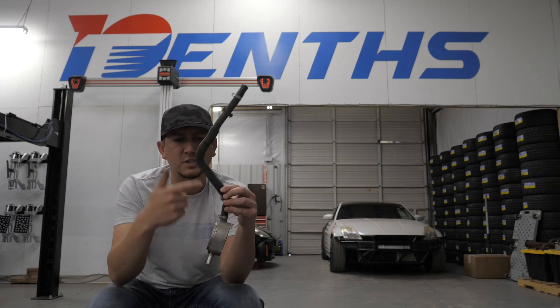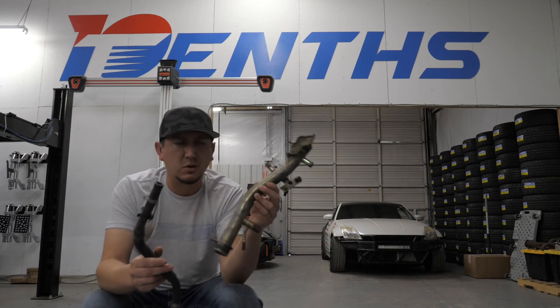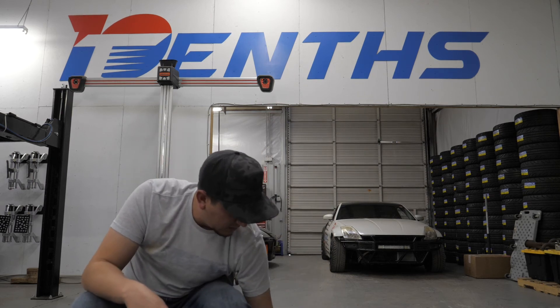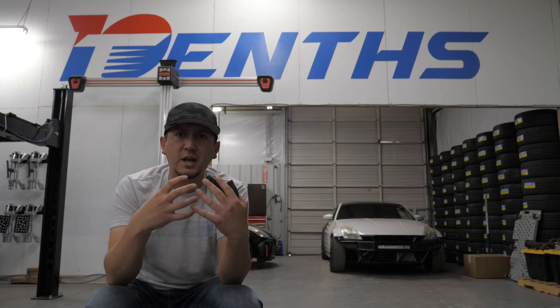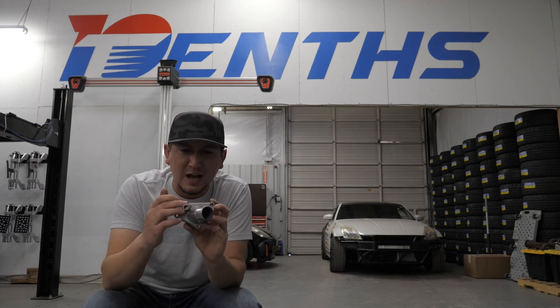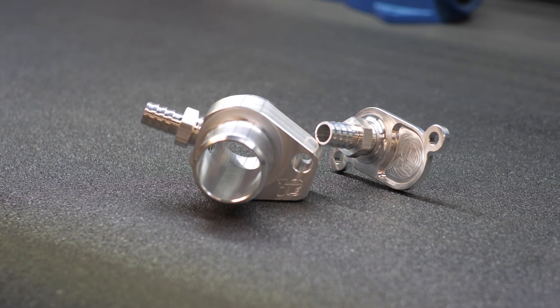This removes two hoses — one fed from what I believe is called the crossover pipe, going across the front of your engine, and then a hose that goes to the front of your thermostat. With our two kits, for the thermostatic one you're not getting rid of the thermostat housing — you'll receive a thermostat housing that's already been modified. And for those paying attention, our thermostatic CSK kit comes with a thermostat housing that no longer has this nipple but still maintains the thermostat and all of its functionality.